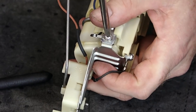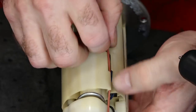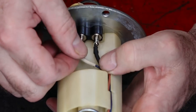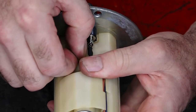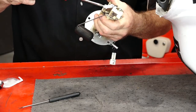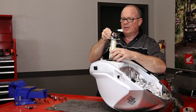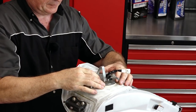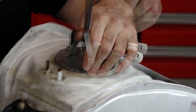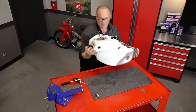Don't forget these two ground wires. Remember, the level sensor goes to the red wire, and then our motor actually goes to the yellow with a red stripe. With the assembly back together, let's go ahead and get her put back in the fuel tank and get our five millimeter Allens back in. With this snugged down, let's head back over to the machine and get it reattached.